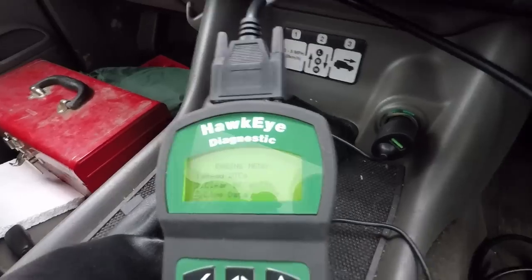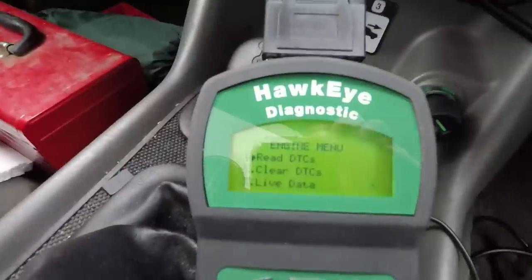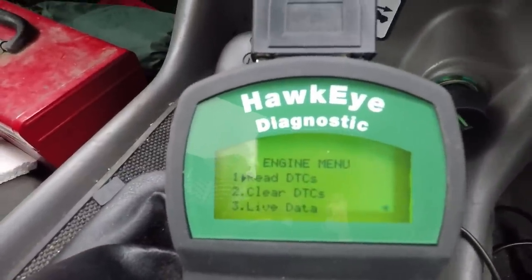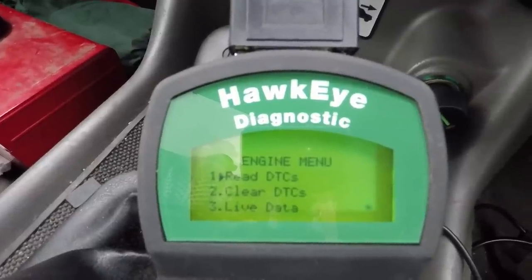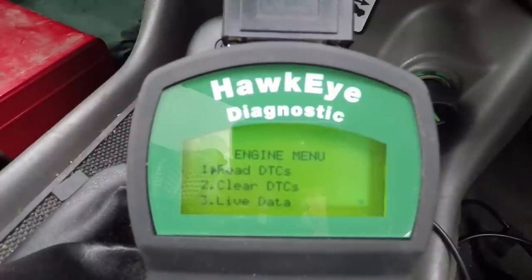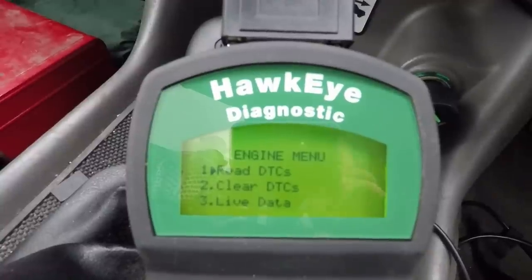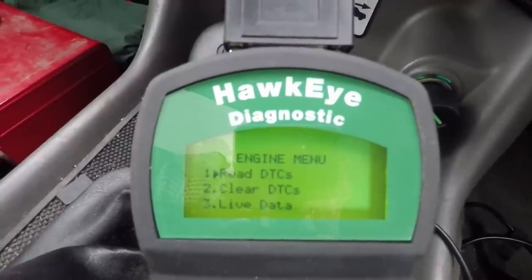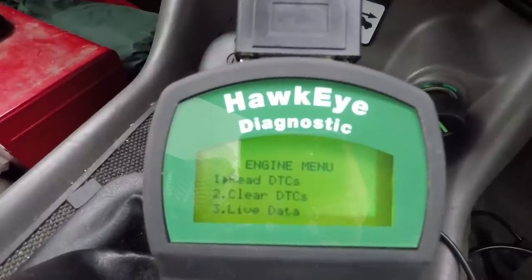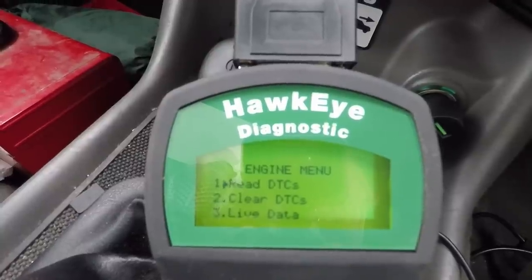I was expecting more than that. I did have the three Amigos on this car for quite some time. I used this Hawkeye to find out what was wrong, and it turned out I needed to change the ABS sensors. I went and changed those and the wheel hubs as well, and they all cleared. You can actually reset the codes in here — if you wanted to temporarily get rid of the three Amigos you can clear the DTCs down, and they may or may not come back.